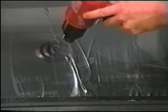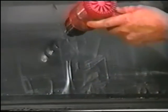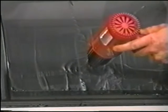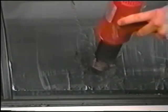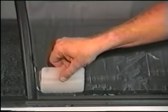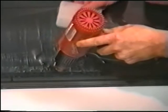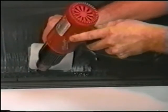The fingers will only shrink toward the factory edge of the film due to the grain pattern in the film. The film may distort if shrunken against the grain. Once shrinking is complete, the film should be evenly flat with no ripples and now ready for installation.